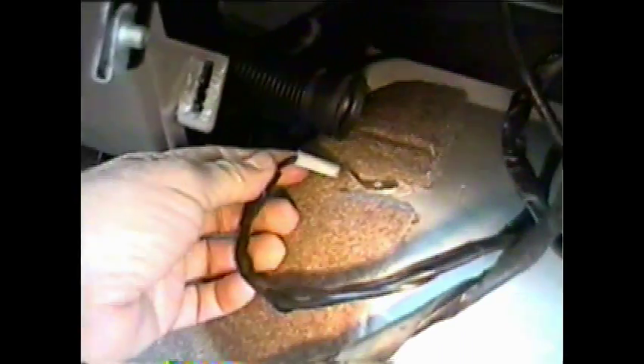There are two little pulls — supposed to be two little pulls that you can grab here and pull it back once you get those four bolts undone. Once you get that air conditioner duct out of the way, it's a little easier to get to the bolt on the right-hand side. I've done this a number of times, but today I'm just showing you how to do it. You might want to take this ground connector off before you remove the cowling.